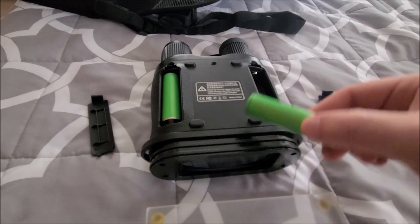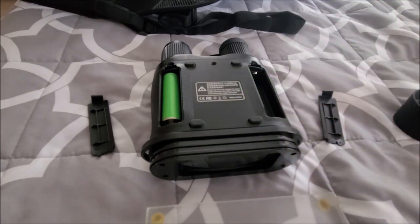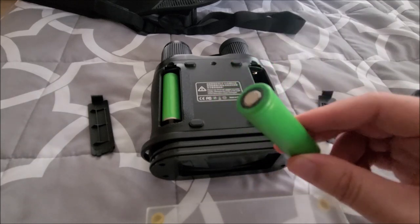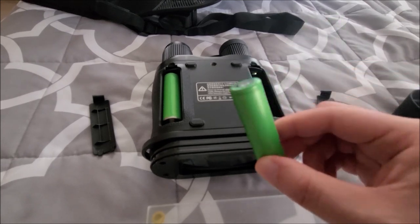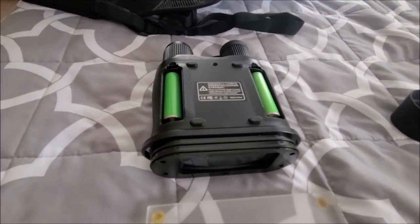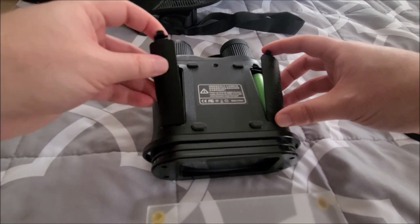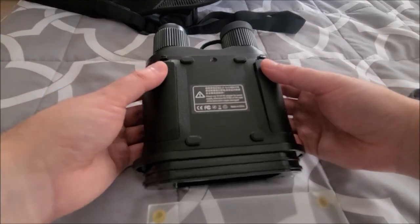I'm going to assume that the charger inside here, because you can charge the batteries off of USB, does have protection. But because these cells don't have undervoltage protection, this could actually drain the batteries completely, which would kill them if I weren't careful. But yeah, I would suggest just getting protected cells, and then you won't have to worry about over or under charging or anything like that. Anyway, this is good enough to test on, so this is what I'll use right now until I can dig up a pair of actual protected cells.